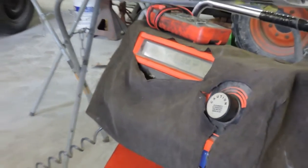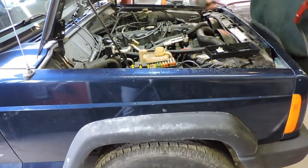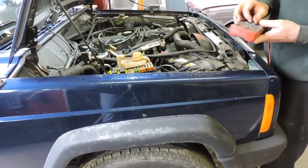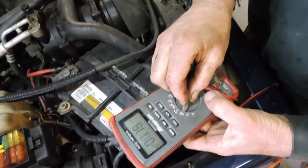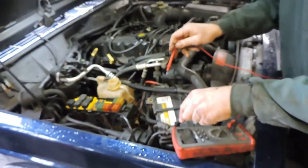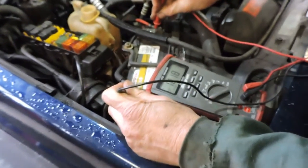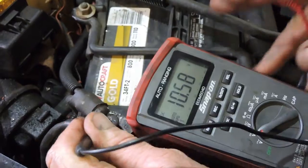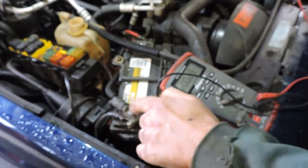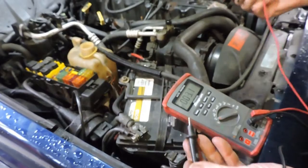The other thing I want to do is make sure my connections on the battery are good, so I'm going to perform what we refer to as a voltage drop test. To do that I'm just going to use a regular handheld meter set on a volts DC scale. I can do voltage drop testing between the battery post and the cable connection, the battery post and the physical ground of the vehicle, or the battery post and the starter on the positive side — just depends what I'm looking for.